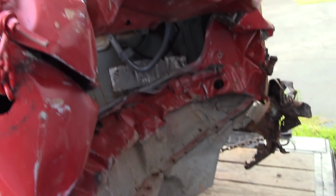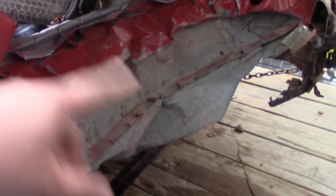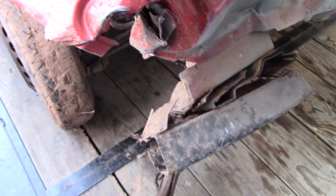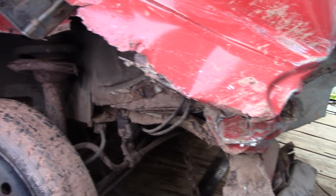Yeah, there she is. So, we didn't have this one tucked, so she kind of blew apart, but really not horribly. I mean, the sheet metal itself is coming into the trunk. This part will pound down a little bit. That'll be fine. This frame rail's tipping down a little bit, but that's an easy push back up. And actually, I think that's going up. It just snapped right there. Yeah, I'd probably have to agree with you on that. So, we'll make sure that it stays going up.